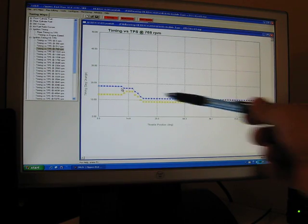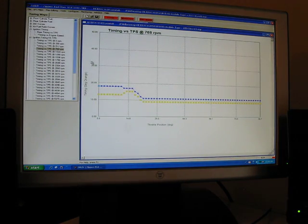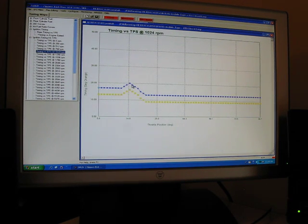This is something that I do the whole way up through the RPM ranges. For today's video, we're just going to work on the idle. At 1000, based on the adjustments we just made, we're at roughly 20 degrees timing at idle. I'm going to smooth this the whole way up. Increase the timing 1 degree on the left of the throttle at idle indicator.